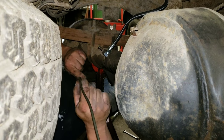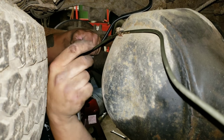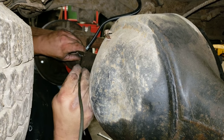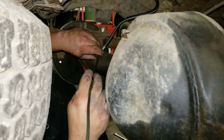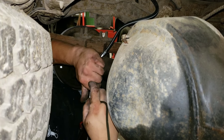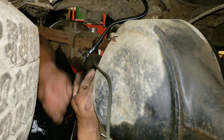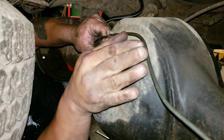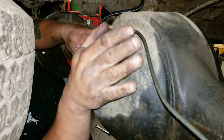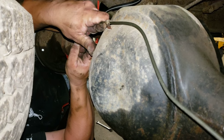So now we'll take our very loosely bent brake tubing and thread it into our hose here. I just need it finger tight. And I'll start applying some bends to it. Get it more uniformly put on. Put this in the holder like the old one was. Start bending it, making it a little straighter, just to make it look a little bit better factory. I like to have it looking more like a factory bend than just some jabron in Wisconsin bent it.